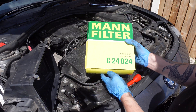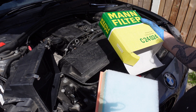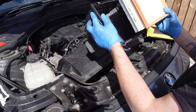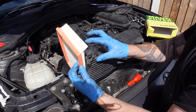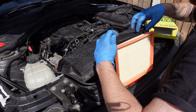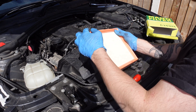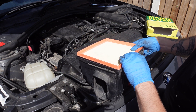New filter — I went for a Mann filter. It's what I've used previously, it's what I've seen recommended. They're made in Germany, not China. They're OEM quality — they make good quality stuff. Make sure it seats around the edge properly. Make sure your hooks aren't going to catch on it — these hooks can come off as well. Make sure you don't lose those hooks because if you drop one down in your engine bay you might never see it again, and then you won't be able to secure your air box properly.